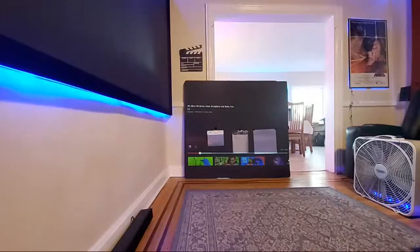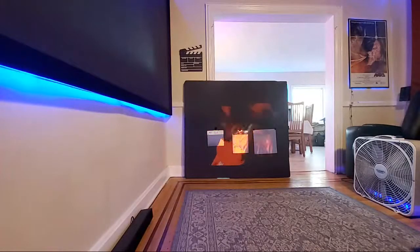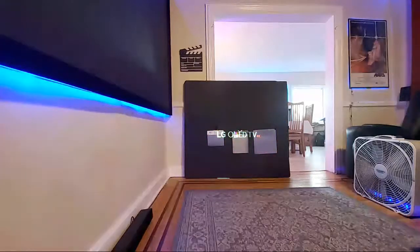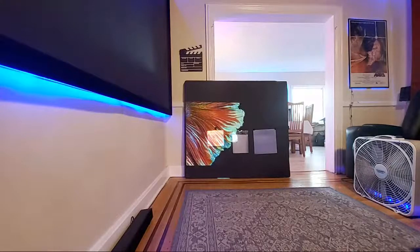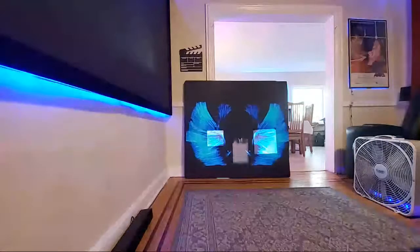Somebody once told me that basically every time you go in and change the settings on your projector, you're fully calibrating your projector. No, these screens are supposed to be ambient light rejection. If your screen is ambient light rejection, you should have no problem with the color fading or washing out. That shouldn't be a problem at all if it's designed to reject light, because light is the one thing that's going to cause your screen to wash out and fade. So if it is true ambient light rejection technology, you should not be having a problem. And then you'll have some that'll argue and say, well, you've got too much lighting in your environment. That is not an argument you want to start off with.